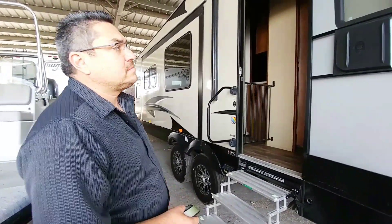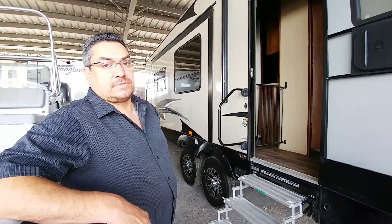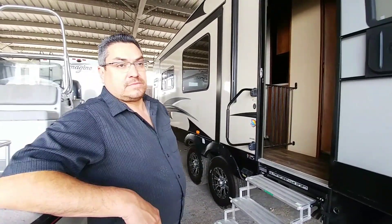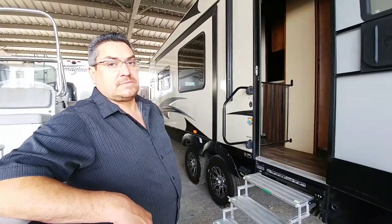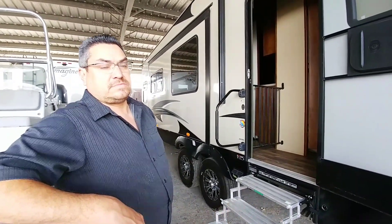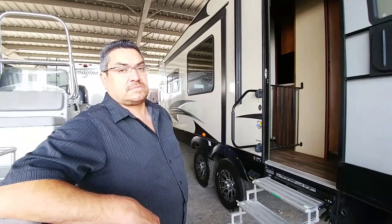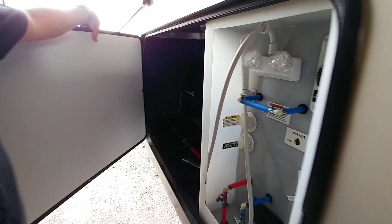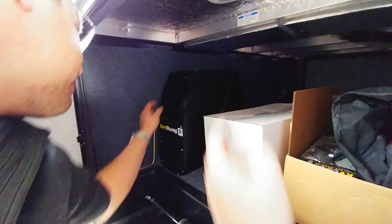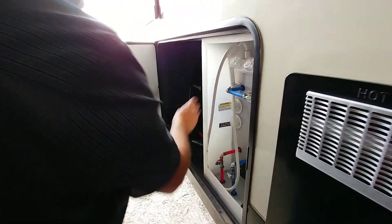One thing to keep in mind: if you have the RV in storage, anything drawing from the battery will kill the battery, especially if it's in storage for a month. This has a power disconnect from the battery, which basically disconnects everything that draws off the battery, but still allows the solar panel to charge the battery. If you accidentally keep the battery on and it's in storage, you're likely going to come back to a dead battery, because things like your smoke detectors, carbon monoxide detector, and even small systems attached to your inverter will all cause a parasitic draw. In this front storage basement area, right next to that cord reel on the other side at the top, you'll feel a plastic switch — rotate it and you'll get power back on, and you can already hear the inverter kicking on. So that is what you're going to want to turn off.